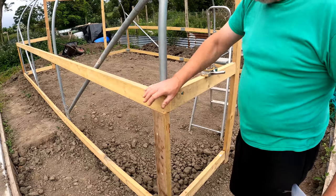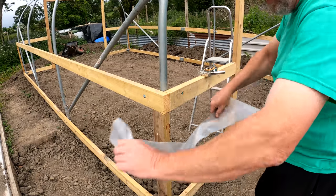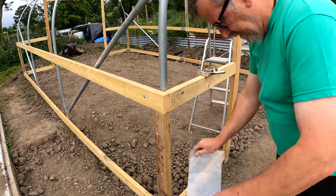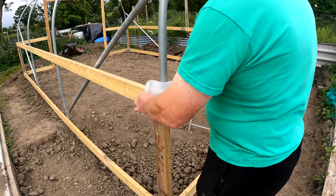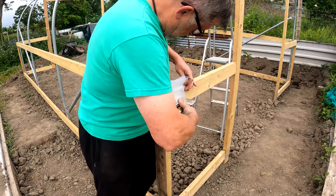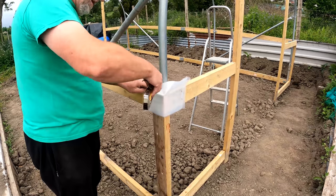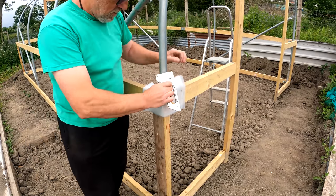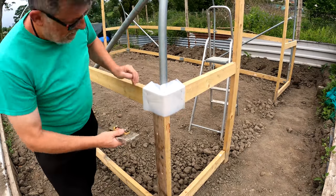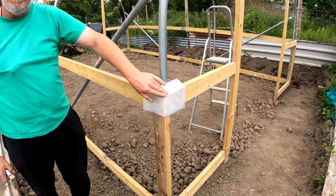Here's a decent little tip — there's the edge of the side rail, there's a heck of a point in there and the cover is going to be stretched down over the top. So on a spare bit of plastic I'm just going to fold it over a couple of times and wrap it round. This will just take the sting out of the tail when you later tighten the plastic — make that less grabby. There we go, that just takes away that rough edge.